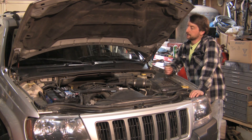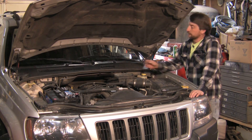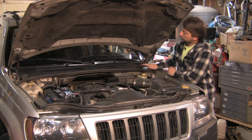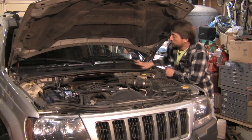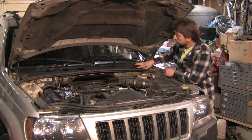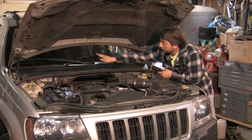You have a few components. We'll start from the end. You have a wiper motor, which unfortunately you can't see because it's back behind this cover. You have two rods coming across from the motor, one going to this arm, one going to this arm — that's what they call the wiper transmission. And then you have your two wiper arms and your wiper blades.